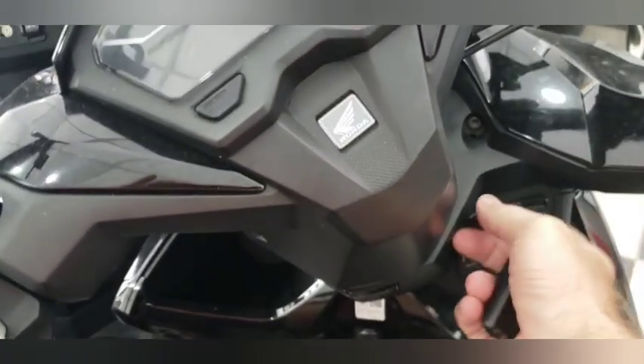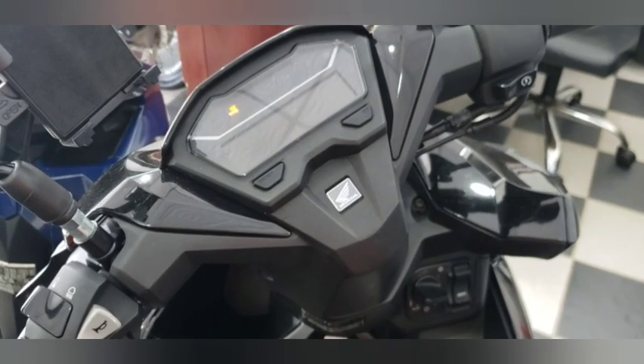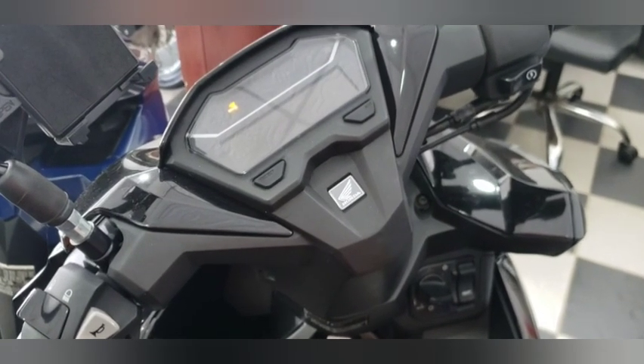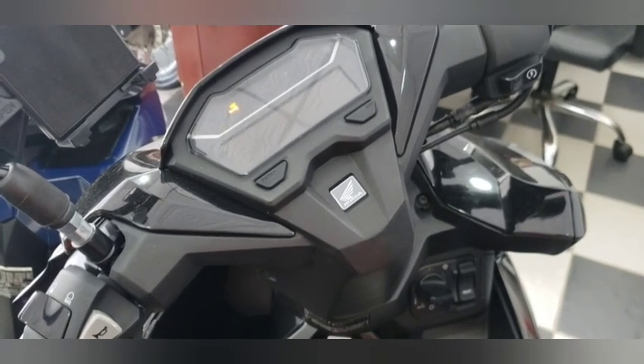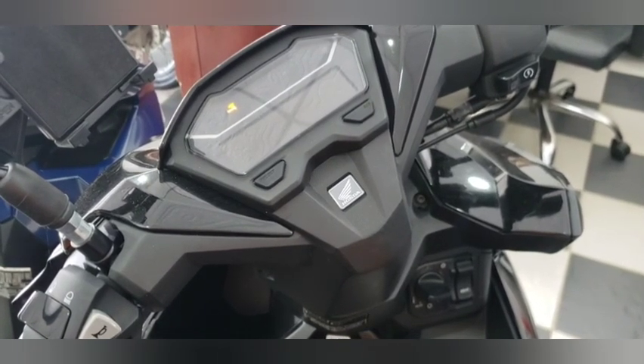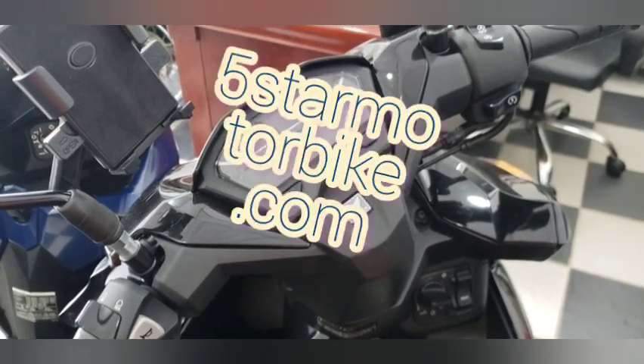The smart key can usually be kept in the right trouser pocket — you do not press it to start. Never put the smart key in the helmet compartment, and always lock models with keys with the steering wheel locked at night to save the battery, because otherwise the key parts will look for each other and overnight the battery could be discharged, even if the low beam is switched off.